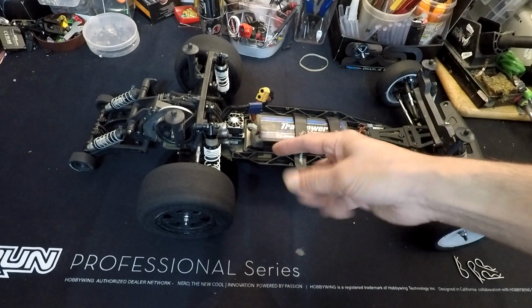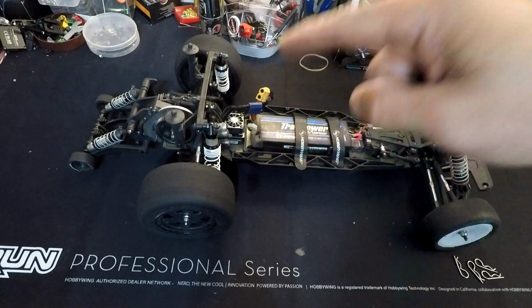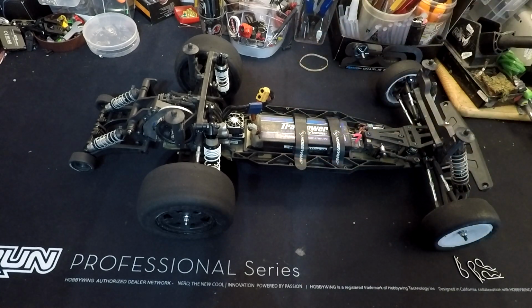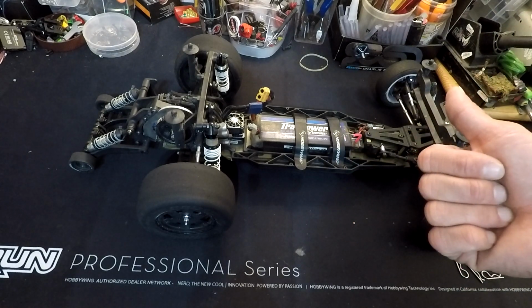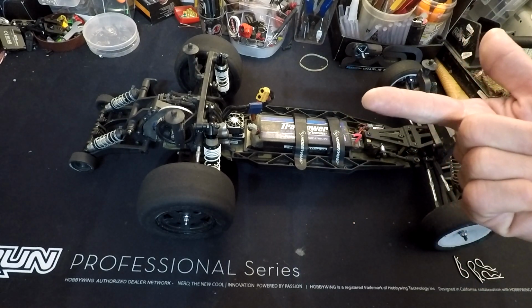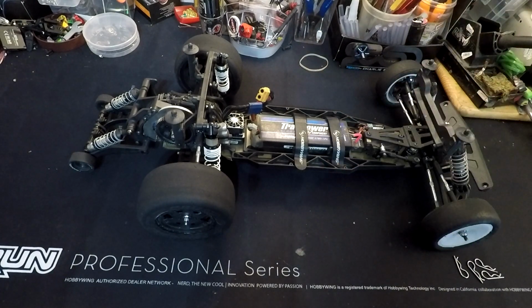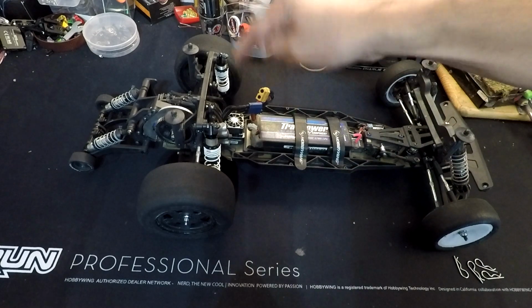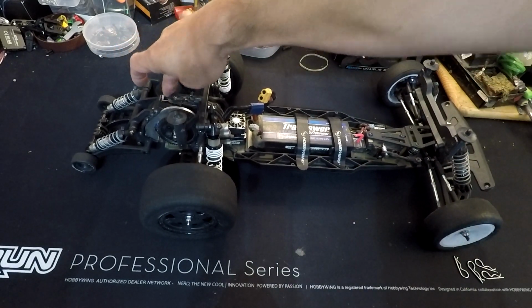The speed control settings are real easy. I'm going to put those down in the description, but essentially it's default settings. I run the turbo timing at 50 degrees, and I have it set to instant with a 30 degree per 10th ramp up and an instant decrease, so when I let off it takes the timing out right away. And then the other mechanical change, I have the motor turned way down at like 20 degrees of timing.